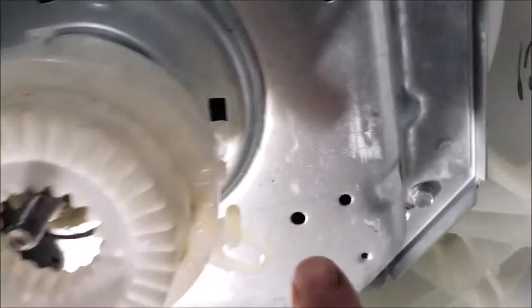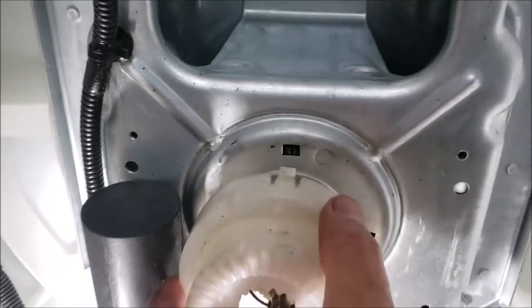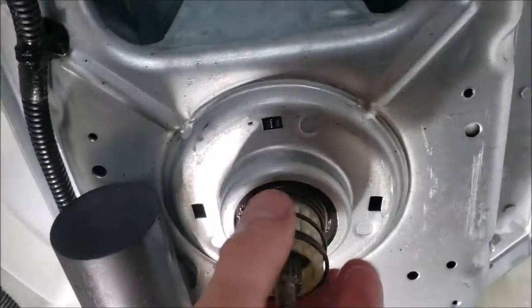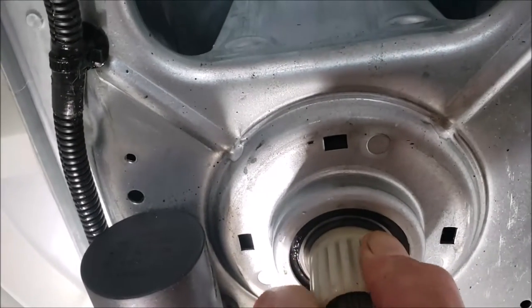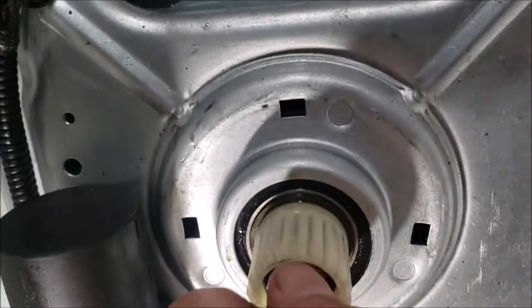I jumped ahead here — I took these two Phillips screws out to remove this little device out of the way, then pushed in on this little clip here, got another little clip, another one on the bottom, and that enabled this to come off. It's like the clutch mechanism. We've got this little spring. I was checking and that's the main bearing — the bearing is good, nice and tight. It's just the seal. You can see the seal there that has failed.